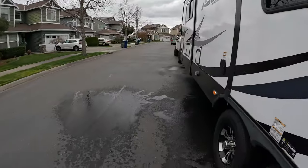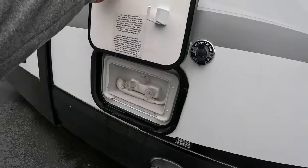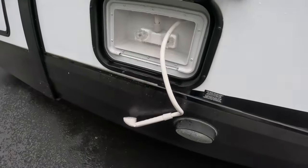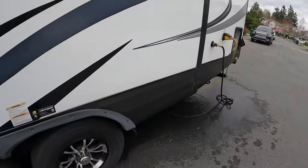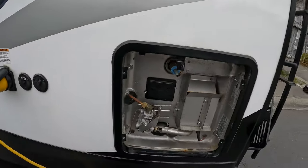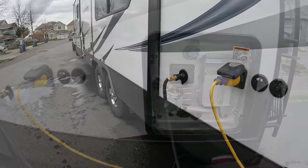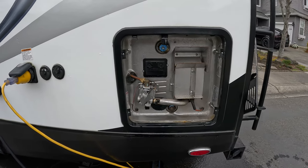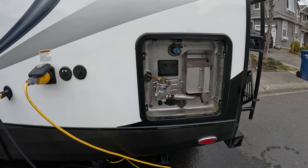Sometimes I'll come down here and open the hot water. Just as such. So the hot water is open. It's venting, so as soon as it gets full, we'll close the vent, and then we'll go down there, close that, and then we'll turn off the hot water. And depending on your trailer, depending on the size of the tank, this could take several minutes to fill up.